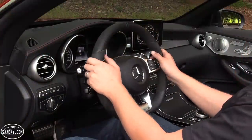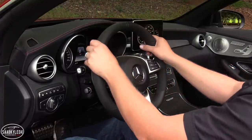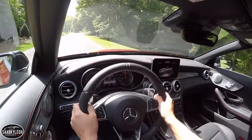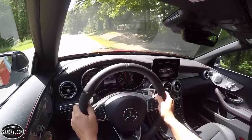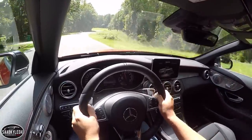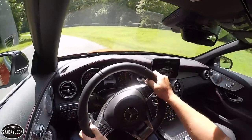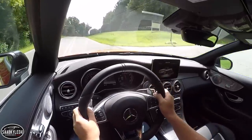The C43's rack and pinion steering is speed sensitive — the ratio actually varies based on your speed of travel. The whole point is to increase precision and response, especially for what this car was made for: spirited driving and some light track duty. There's a lot of feedback from the front end and it all feels pretty natural. You can also adjust the level of assistance through the drive mode, so if you want it a little bit looser in comfort or stiffer in sport mode, it's easily done at the touch of a button.